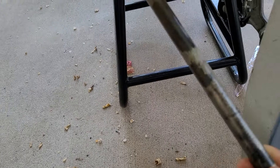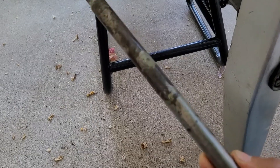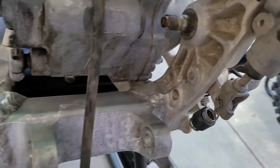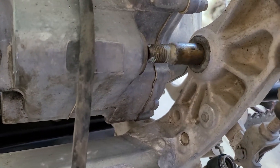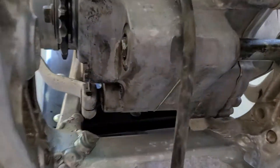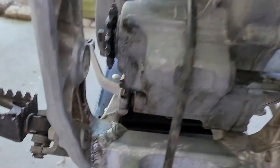The first thing I do is grease your swing arm pivot. This is greased — you can see it's got a sheen to it — but it's greased just enough where it's not going to be attracting more dirt than it needs to. I also grease the inside of the bosses, the bores where the bolt passes through. It kind of goes through all the way. You don't want too much grease, and I'll show you where it'll build up.